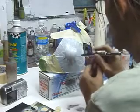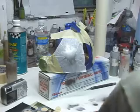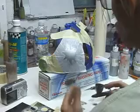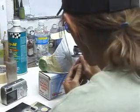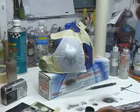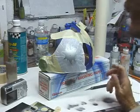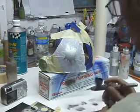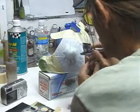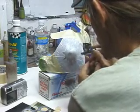Now we have our base color, our orange silver. I'm going to take black, House of Color base again, test my airbrush again — it's over-reduced. Put a dot in the center where our bullet hole center is going to be. You want to use paint, not pencil, magic marker, crayon, or anything else. Paint is only as good as what's underneath it. If you're using some foreign material like magic marker, pencil, or pen, chances of the paint failing are a lot better, so it's not a good idea.